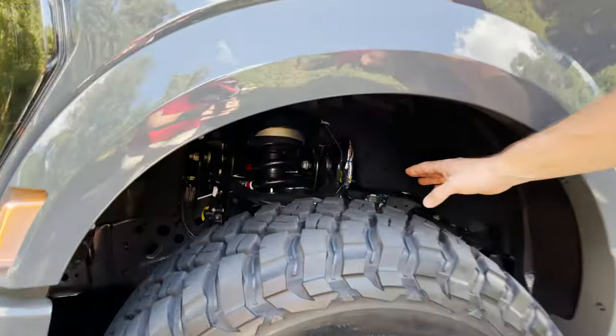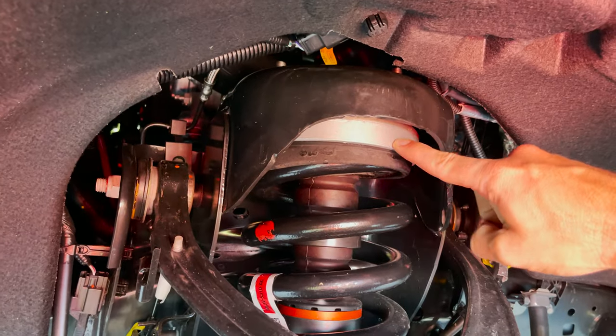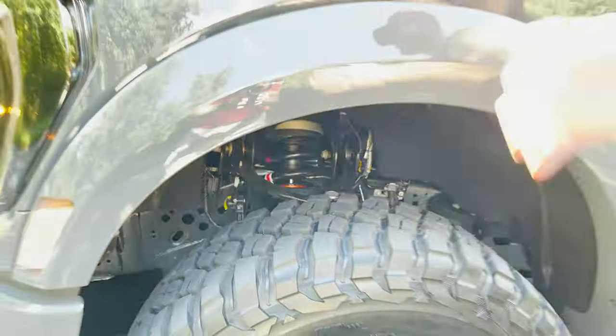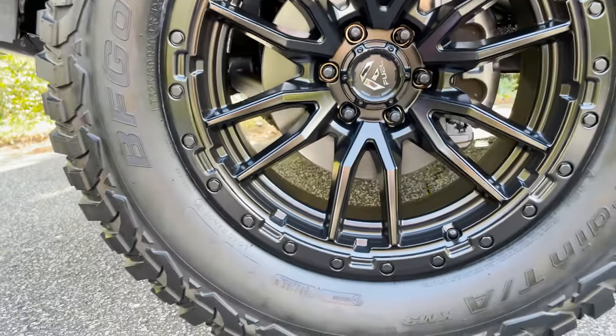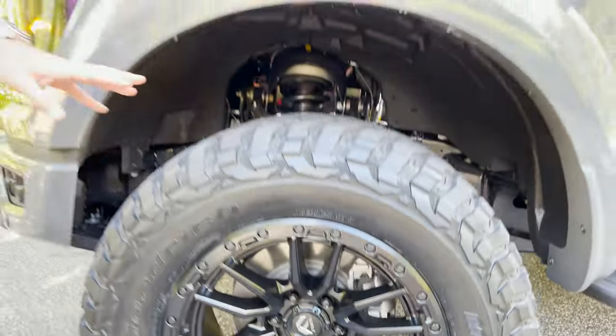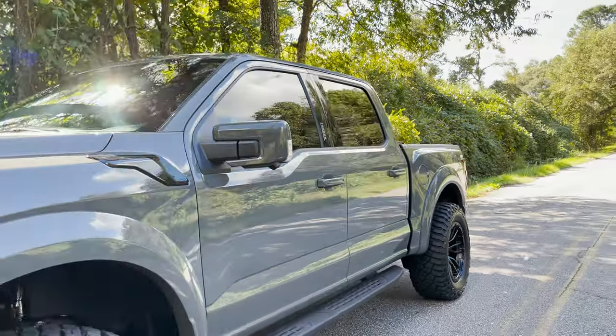Let's talk shocks. The shocks on the gen 3 Raptor are much improved - they're actually larger in diameter, so we had to find a way to level this. We did a Ready Lift 1.5-inch top hat spacer level kit. We know that's not the most legit way of leveling but we have some RPG bottom perch collars coming. This is a viable option - I have this same setup on my Raptor and I'm totally satisfied with the articulation and ride quality. We're rolling on BFG KM3 mud terrain tires at 325/60/20 - an unbelievable, Baja champion proven tire. Let me know about this stance - how sinister and mean it looks.